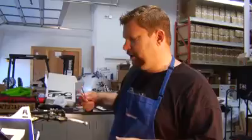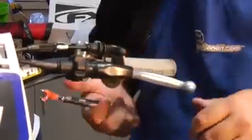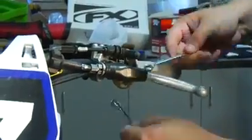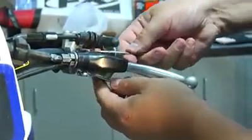First thing you're going to want to do is take your clutch cable off, give yourself slack in the lever up here, and just simply turn it in so you give yourself lots of play in your lever. That makes it easier. This is the Yamaha, but any bike you have has the quick adjust lever. Just simply peel all that back, give yourself lots of room to get in there, and you can take off your lever with a couple of wrenches.